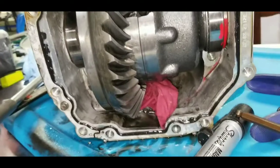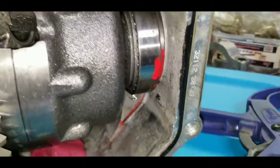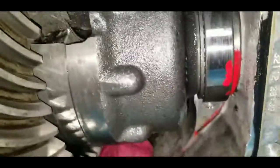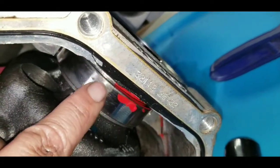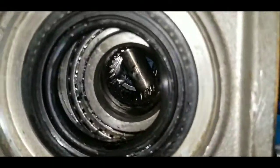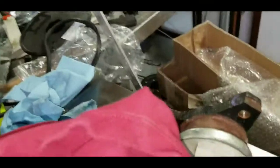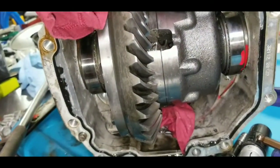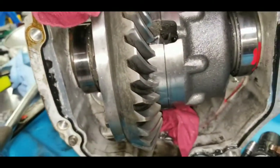You can see the old shirt I'm using as a rag has come through at the bottom and it's starting to get thicker. It's moved the bearing off — those two faces were flush, that shim and the bearing — and you can see now there's quite a bit of gap there. It's moved forward. You couldn't turn the pinion by hand, but just tapping on it with a light hammer — not really beating on it, just tapping — moved it out. I'm going to go ahead and pull it through and pull it out.